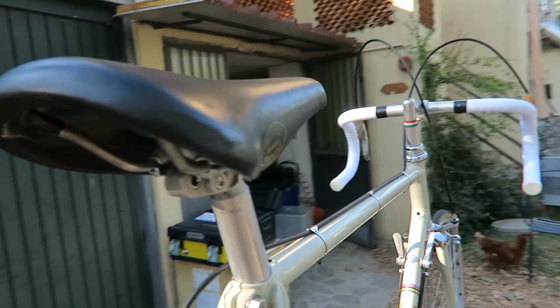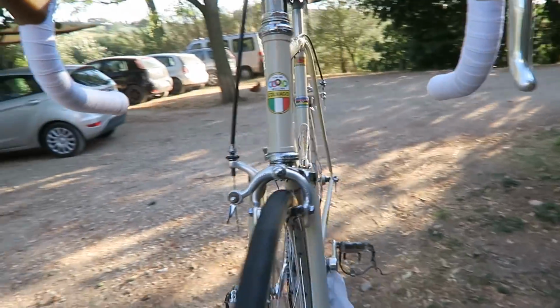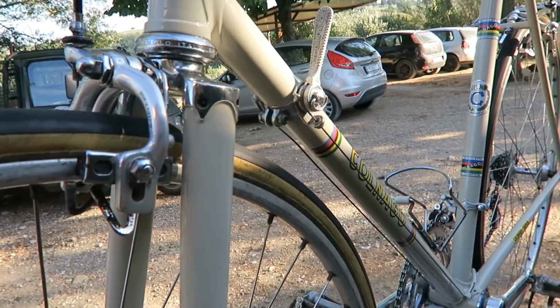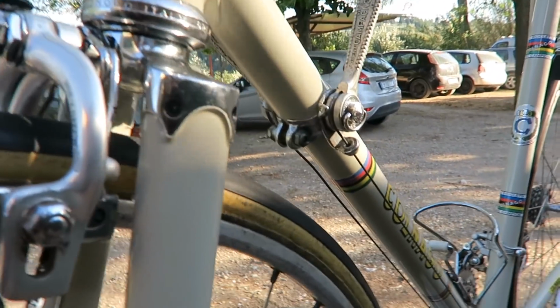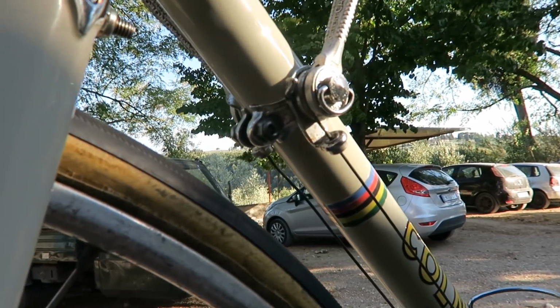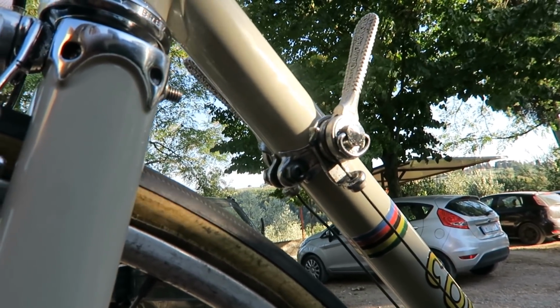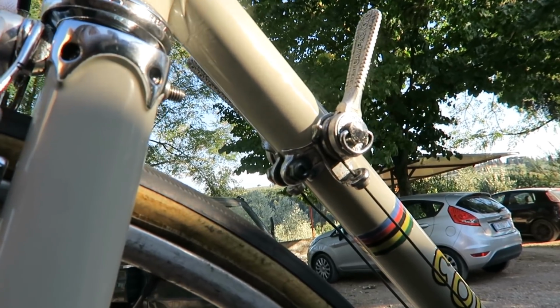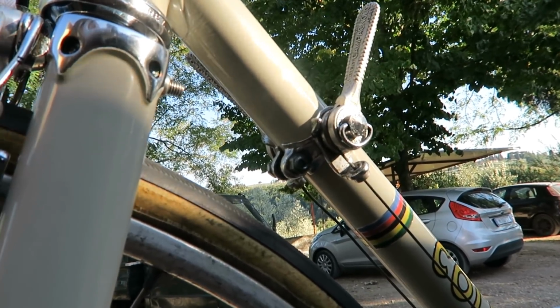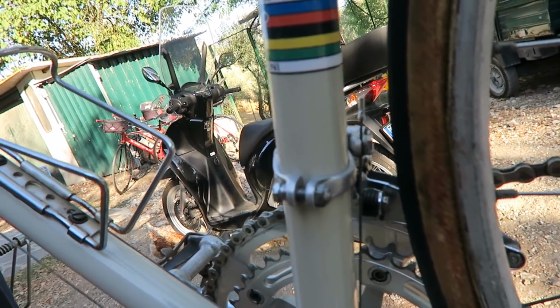The seat looks great. I had a really tough time getting the clamp for the front shifters to catch the nut. It was just really, really short. I think it's because the frame is actually a bit bigger at that point due to a thicker paint job and the transparent coat he puts on. Although I had no problem with the front derailleur, which has the exact same length bolt and the same nut.